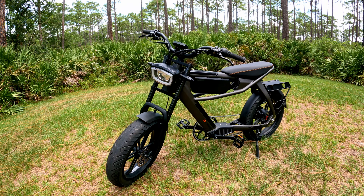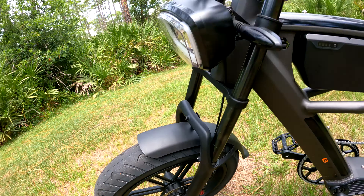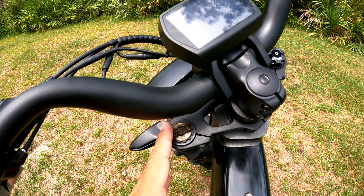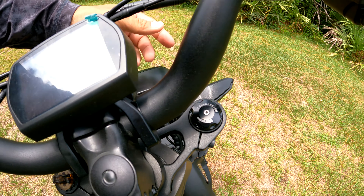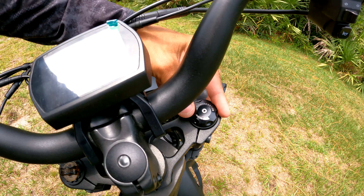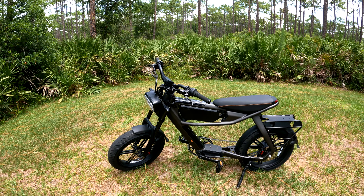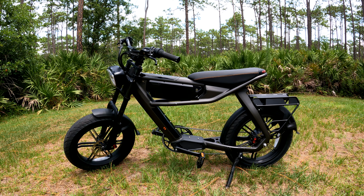By the way this bike looks, I think they want you to use this on the streets — it looks like a street bike. On the front we've got a nice dual crown suspension with preload and compression damper adjustments. The compression damper actually works really well — when riding off-road I soften it, and when on the road I keep it stiffer so there's not a lot of bob while cornering fast.